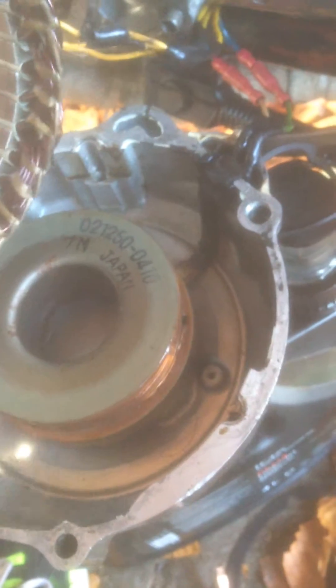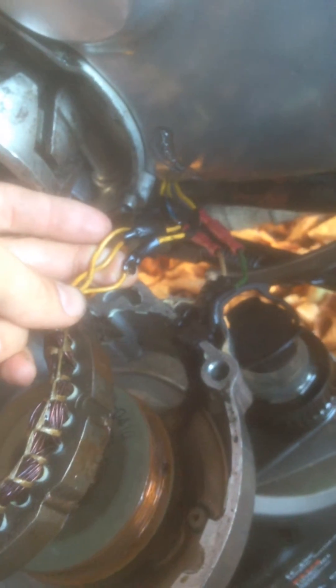My question is: do I have to replace the whole stator? It's pretty expensive — I don't want to do that, but if I must, I'll order one. This is from Denmark, I have to order it from the US, a used one. A new one is pretty expensive — 320 euros. I've also checked the field coil, right there, and that seems to be good — there's no ground. I should specify: there's no ground from each of these yellow leads either. So I don't know what to do from here. The old rectifier is here, which you can see. It's my first project, so I just want to hear what you think and if you can help me.